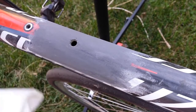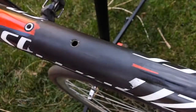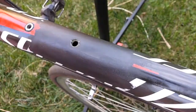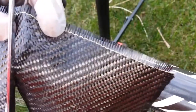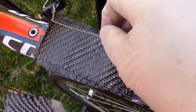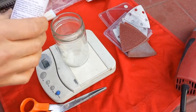I've got the area sanded well enough for my liking, and I've got a paper towel here with a little bit of paint thinner just to clean it up. If you don't have paint thinner you could wipe it off with water and let it dry — just trying to get the grease off so that it's a dry, tacky surface to accept the epoxy. Here's a piece of the fiber — I'm just using regular household scissors to cut this. I've got the fiber cut so it's going to lay in there. I'll put one layer, then another, and stack three of them on top of one another.